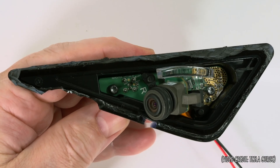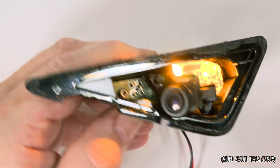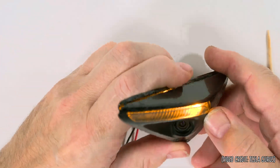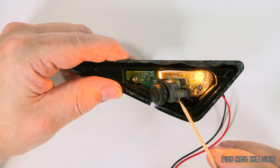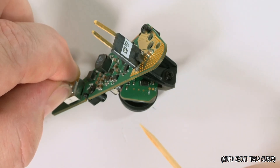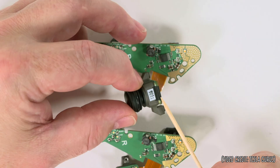The Tesla Guru's YouTube channel has posted a video covering this issue. This shows the area where the LED light pipe is located inside the repeater housing. You can see the camera is in the middle here. When the LED is flashing, there are holes in the camera PCB board that are letting light through right here. Also, there is translucent adhesive around the camera housing that is letting light in.